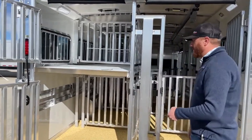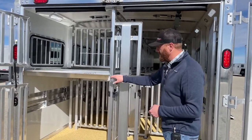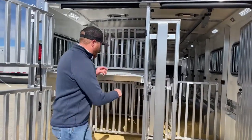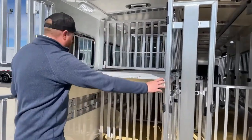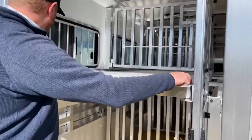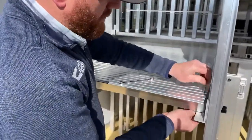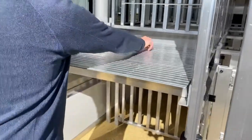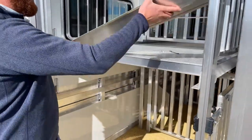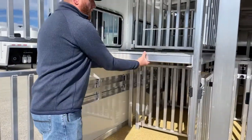You're going to have to lift the animals up and into this, but this deck runs the whole way. This is the same flooring they use on the trailers themselves. They've got a track built that runs the full length here, and we've got a couple of bolts at the back. Once we undo them — it's a 7/16 — and remove them, I can slide it back and start taking sections of this floor out.